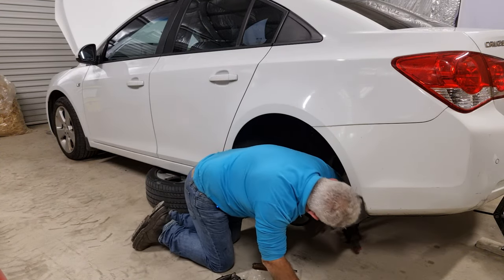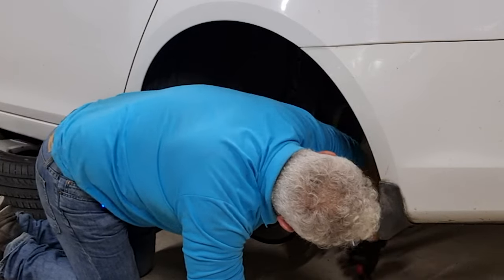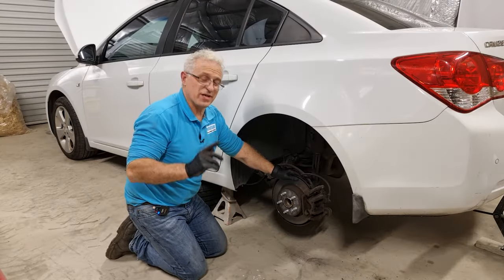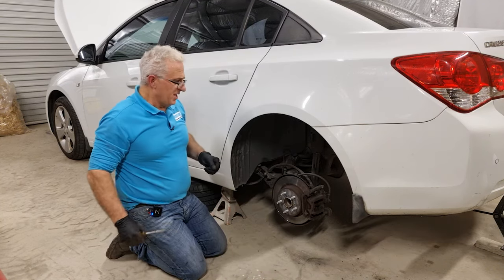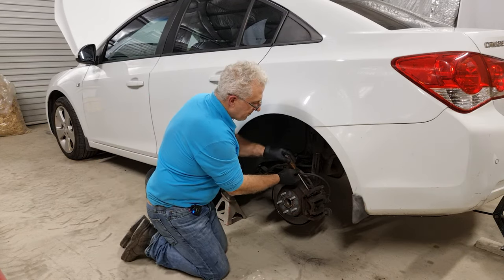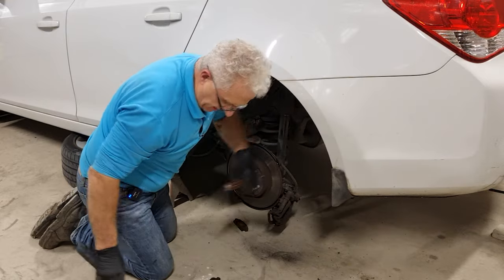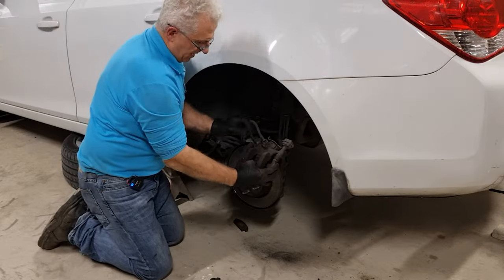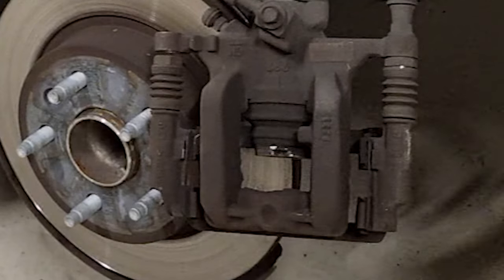You'll find these are pretty tight and you will need tools — you may even need a hammer. Now this part you have to be very careful with. To release the back calipers, you've got to actually lower your handbrake down. So be careful — chock up the wheels and don't let the car roll, because it will move. Just needs a little bit of persuasion. Now you can see that this piston has come all the way out and we've got to bring it back.